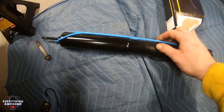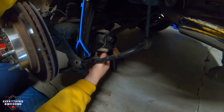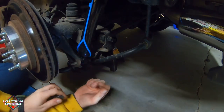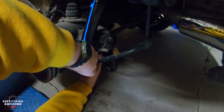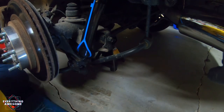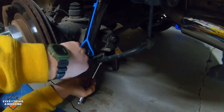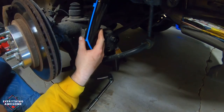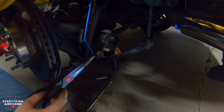Let me get this guy on here. Leave this on and then just cut it off once you get it into position. Lower down on this jack stand. Start the clearance, get this bolt back through - simply slide the bolt back in. Take your nut, tighten this with my fingers, just tighten on. Got that hand tight. Tighten a little bit, enough to where I can still move this around. Now I'm going to cut this blue safety wire - I'm going to cut this off here.